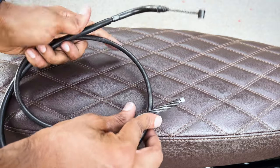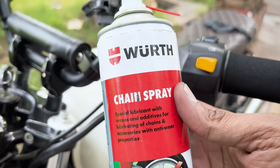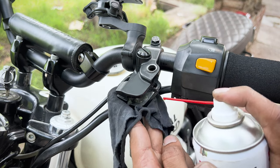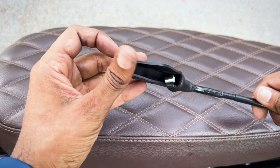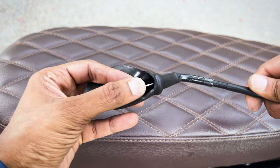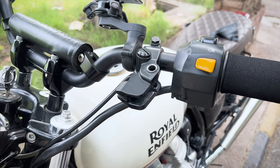You never know when it might come in handy. The fresh lubrication I'll be using here is a chain spray from Worth — it is very good for joints and hinges and has really good adhesive properties, so it should last a while. I have also installed a rubber sleeve on this clutch cable as I live in a very dusty area and I'm constantly under fear that it might break some day while riding. You can easily get this sleeve from any local motorcycle parts dealer.